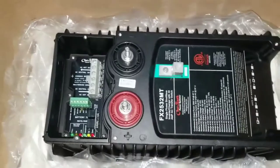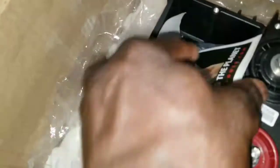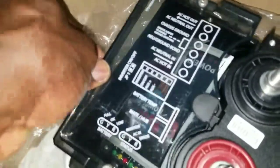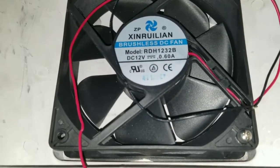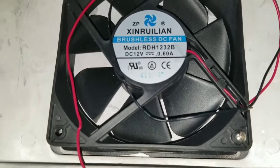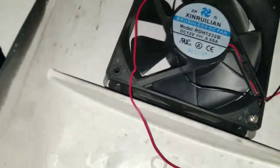They sent me something, so we got this figured out. We're going to have all this back together until we're ready for testing. The fan wire is going to lock into that plug. Just decided to show you guys — maybe you find it interesting. There's 12 volts on the fan and it only draws half an amp DC. There's a built-in relay inside the inverter that opens and closes to control it.